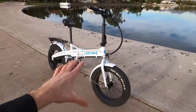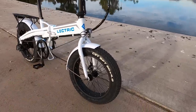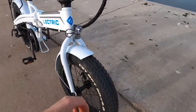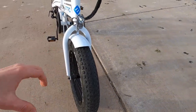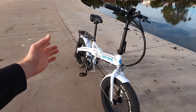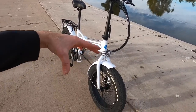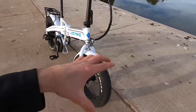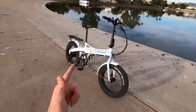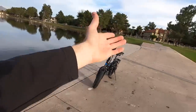These bikes are slightly lower, making them more approachable and more compact when folded. The tires are CST BFT — Big Fat Tire — 20 by 4 inches. The 4-inch width gives you a nice stable, comfortable feel with more air volume than a traditional 20-inch folding bike with 2.25-inch tires. There's a bigger contact patch and more grip. You can run them from 5 to 30 PSI — currently riding at 20 for a mix of comfort and efficiency.